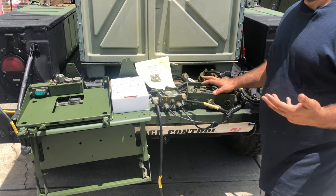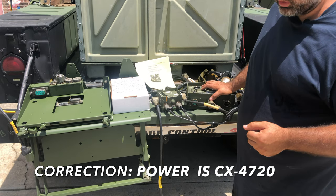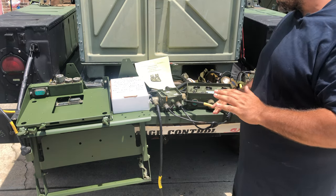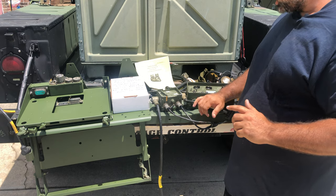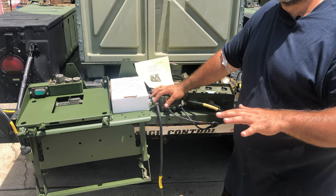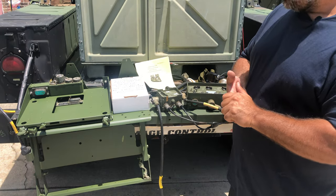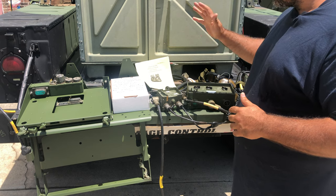You're going to need a power cable — it's probably already in your truck. If not, it's the CX-4721, and you run it from your starter between the firewall where your battery box is underneath the truck. That connects to the J508 port on your intercom. Then you need audio cables — the CX-4723 — to run from your 1780 to your crew boxes. Figure out crew box placement first so you get the right cable lengths. Then you need your bailout cables and headsets. You can set up a two, four, or six station configuration — whatever is appropriate for you.